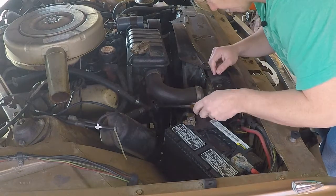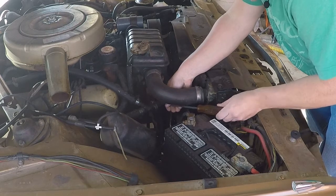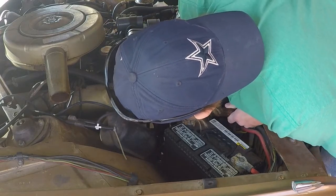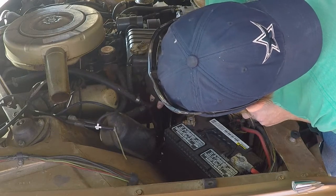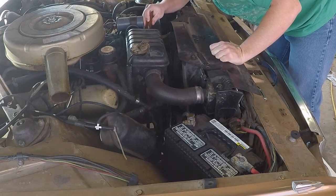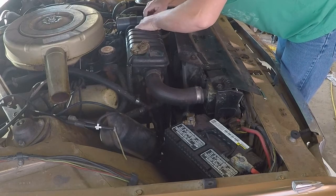All we've got to do is take off a couple of hose clamps — flat blade screwdriver, not Phillips head — and try not to break this brass junction right here because I'm sure it's gonna be stuck. Easy fix. The other one's down here but they put it the right direction, so it's easy enough to get at with a long screwdriver.